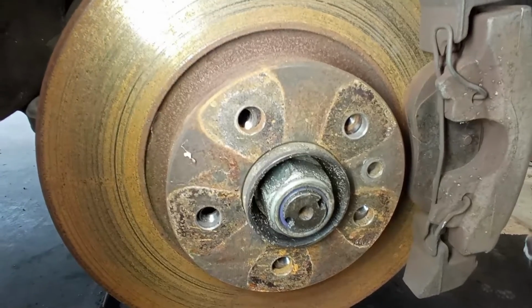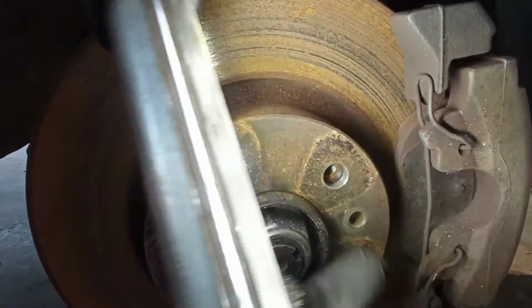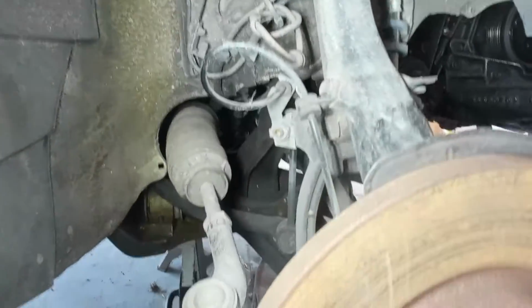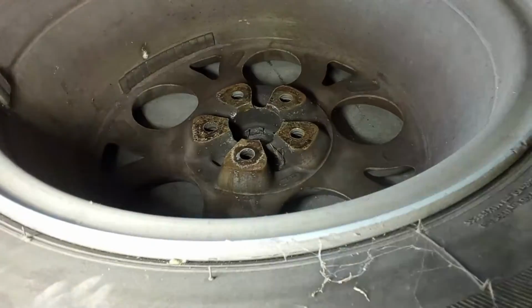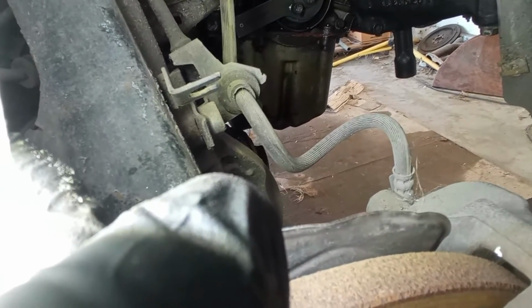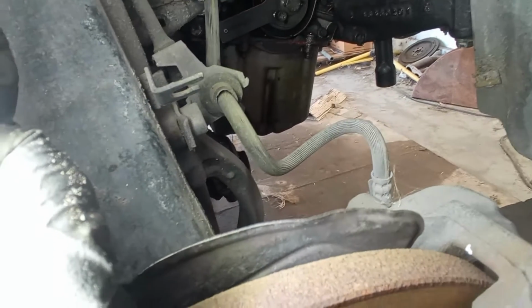Just a heads up over here. This is not the nut to go on the transmission side. The guide over there is missing because someone broke the threading. The ABS cable is not like this, and it is rubbing on the wheel, because you can see the mark on the wheel over there. That nut is not from there. This flexible hose is completely torn. It's completely screwed up. I have to put this as it should be.